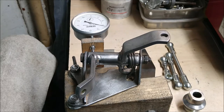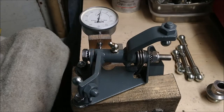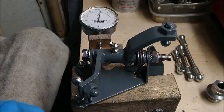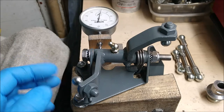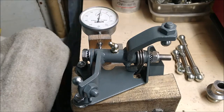I'll just show you the modified version. Here we have the modified version — much thicker through-bolt hinge running all the way through it. The base plate has been drilled to 10 millimetres to accept that, which is 9.9 millimetres actually. It has bearings now the whole way through it, all the way down — not just the little nylon bits on either end like the original one did.